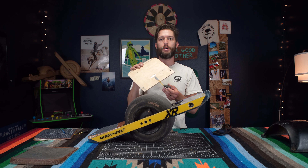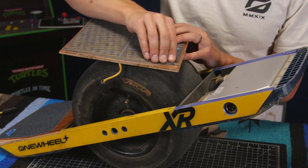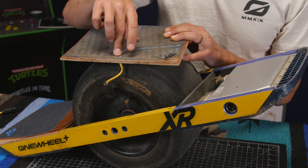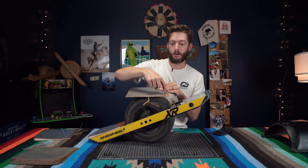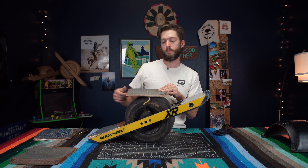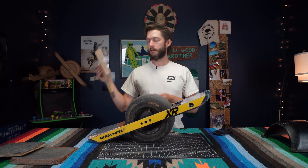Once you've gotten your connector unfastened, it was clearly time for a fresh set of foot pads. I'll also point out that sometimes if you over-tighten your fender, you're going to end up with a grip tape issue. This is not an issue with the grip tape itself — it is from over-tightening the fender. Obviously this won't cause any issues with your foot pad sensor, as there is no sensor pad underneath this particular part — the sensor is more within the center of the foot pad. But it's a good time to get rid of this worn grip tape and throw on the fresh one.